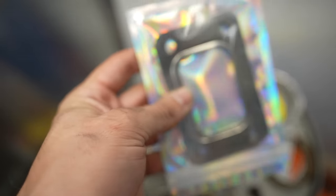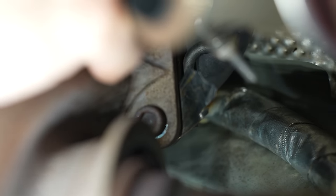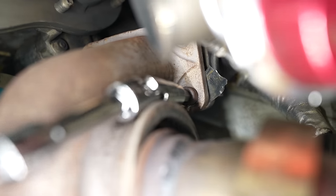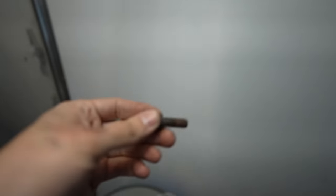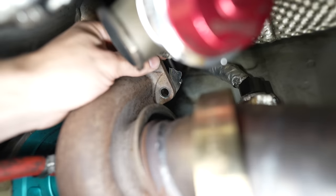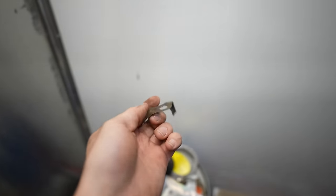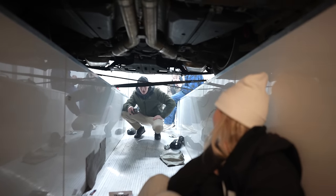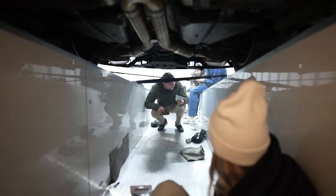Check this out — this is a thick, non-pliable metal gasket, you can't really bend this. Let me show you the type of heat this thing generates. That gasket up there is just straight up shredded. Let me get this last bolt off so we can find out what's going on. Last bolt out. Let me get this piece of gasket out of here — how does that even happen? That's not supposed to be like that. Let me pull the turbo down some more to see the other one.